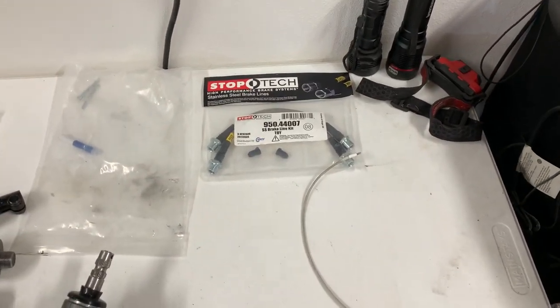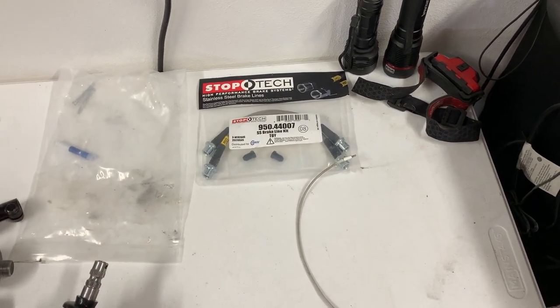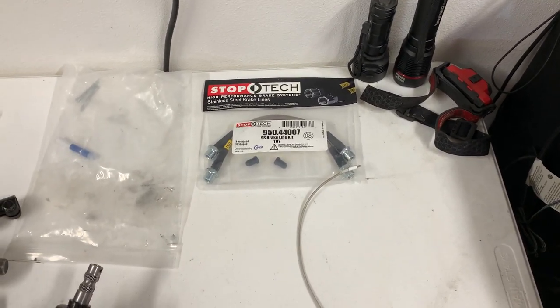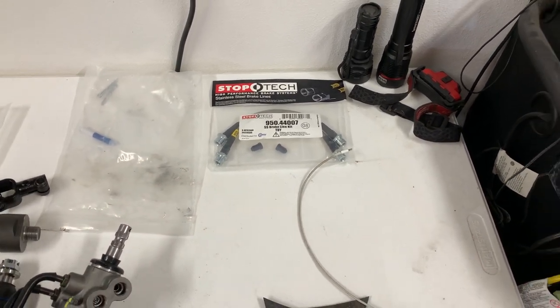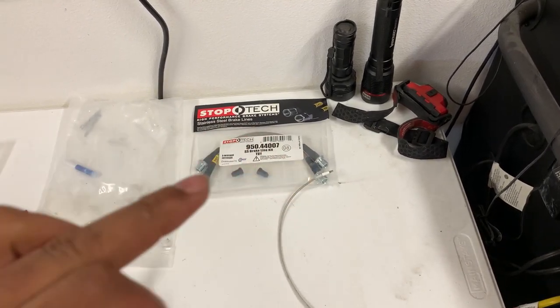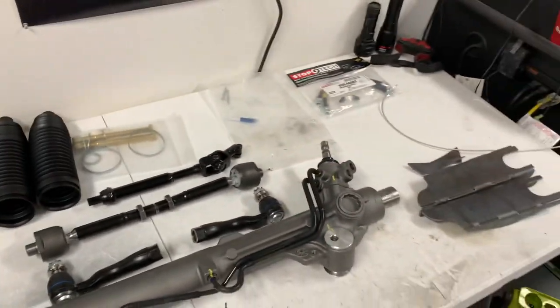I have the rears on the way; they were back-ordered. I bought these because when I had my G-Wagon on the channel - that was on 34s about a year ago - I did steel braided brake lines and it made a huge improvement with braking feel. They just weren't spongy and it definitely stopped better as well. I think that has to do with the rubber expanding on the stock lines, and these don't have as much give for expansion when you put the pressure through - so I guess that's why they work better. I liked them so I bought them for the Tacoma.